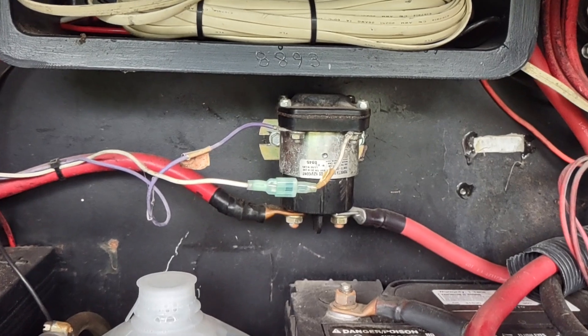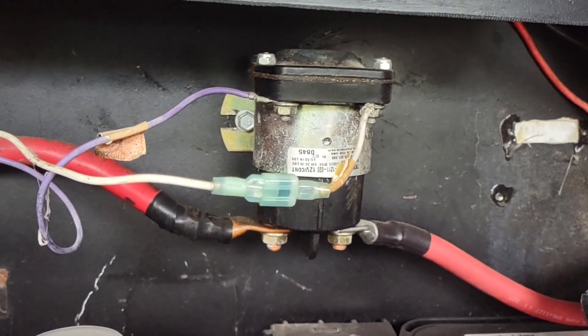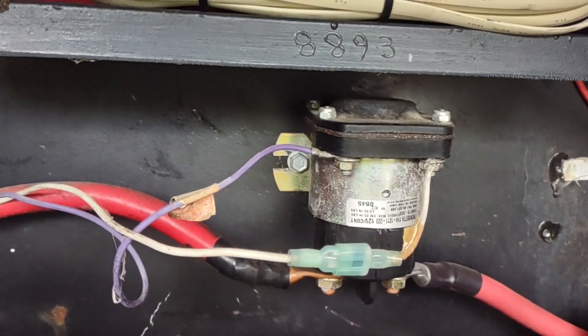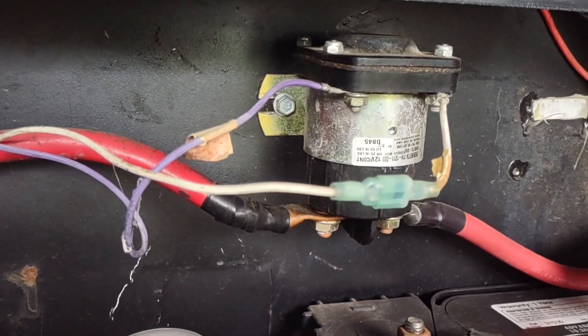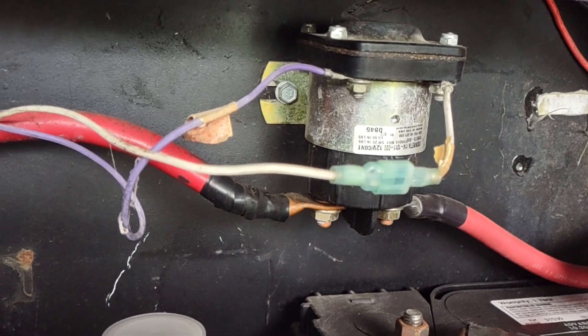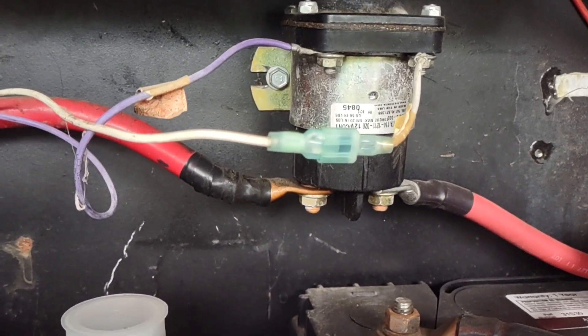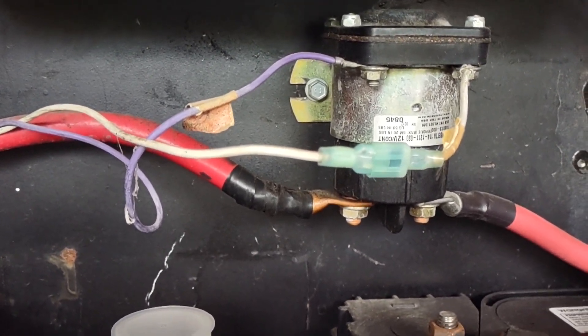The BIRD board in the front run bay on this year and model is a bi-directional relay delay. It turns this relay on — often called the big boy — via the purple wire. It sends 12 volts to that purple wire. The white wire is the ground. You could reverse those wires and it wouldn't matter; that solenoid does not care.